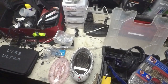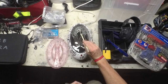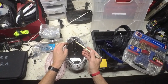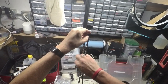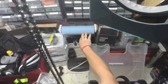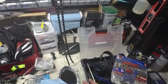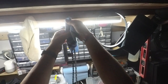Can't forget I've got the quick links in there. I usually use a chopstick to help with this part. This wax is not too hot to touch — this is a wax bath designed for dipping your hands into, for soothing them, for arthritis or whatever — but the chain holds a lot of heat and conducts it pretty well, so sometimes I like to let that cool down for a second before I touch it. I've got some nails up here, and I'm going to hang this on a nail where it can drip into the wax. Then, just like you wipe off excess liquid chain lube, I'm going to wipe off the excess wax here with a paper towel. If you get this stuff on your hands, it is black from the molybdenum disulfide, but once it cools down it'll just scrape right off — won't leave any marks at all, don't even need to wash.